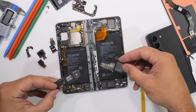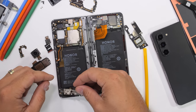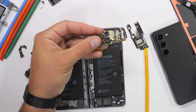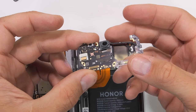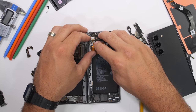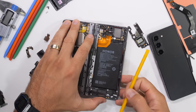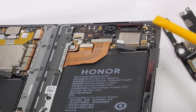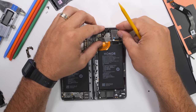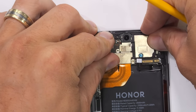Not going to lie, it's rather strange assembling a phone that I didn't take apart myself first. It's like a high-stakes version of that puzzle ball for kids. Luckily all the circuit boards can only fit in one place inside the milled-out frame of the V2, so as long as we don't force anything in we should be just fine. The secondary motherboard has yet another 16-megapixel selfie camera that points out the front glass. I assume now we use the remaining three Lego-style ribbon connectors to connect both motherboards through that hinge. Before attaching the rest of the cameras, we can see that there is an upper stereo loudspeaker with waterproofing mesh over the speaker opening, so there is some protection against water and dust. The blue sticker is what's containing the little foam balls — they're what help the speaker sound bigger than it actually is.